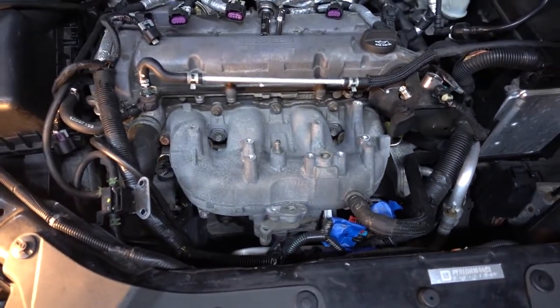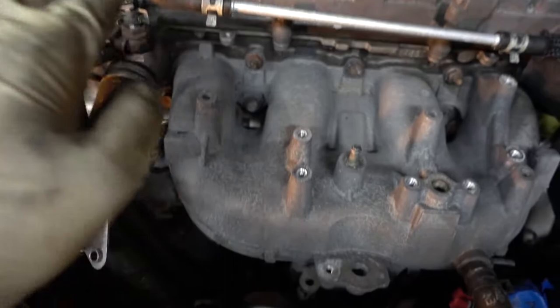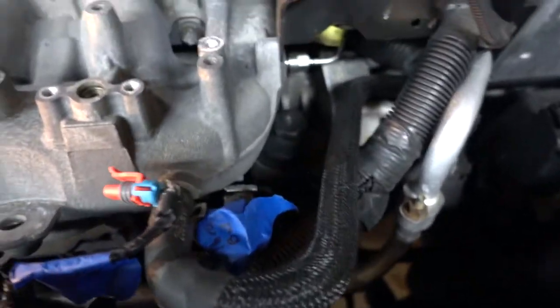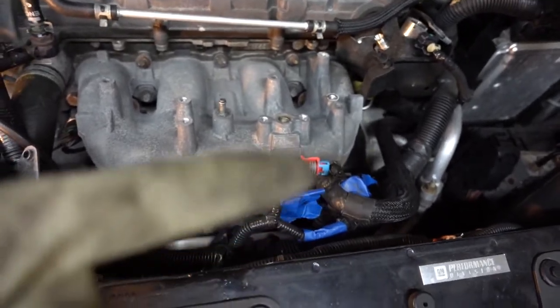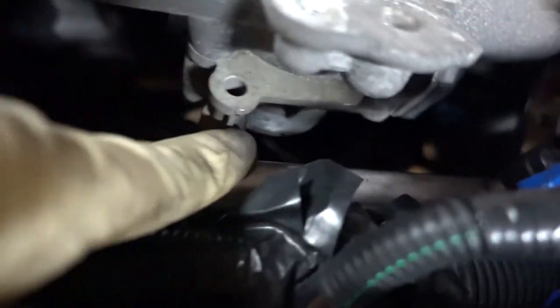Just a little update — my camera is very low on battery. I took everything off the intake manifold: the solenoid, MAP sensor, boost solenoid, the high pressure fuel pump, and the anti-pulse thing. All the connections I labeled, as I showed you earlier. I also took the dipstick out, took the lower charge pipe off, and unplugged the throttle body. Basically the intake manifold is pretty much ready to come off. The guide on cobaltss.net is very helpful and took you through everything you needed to do.